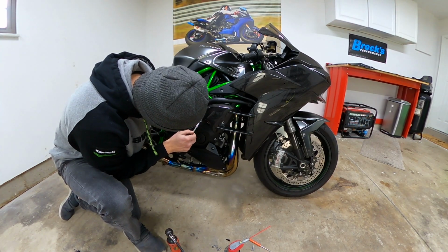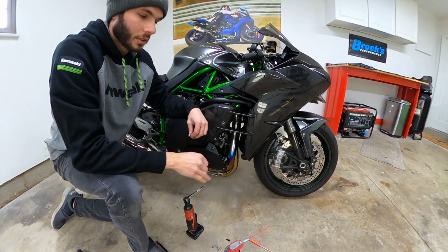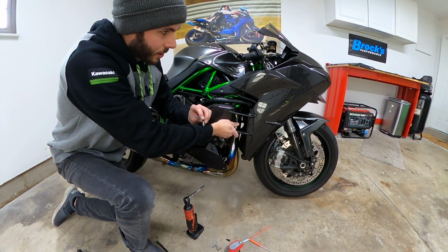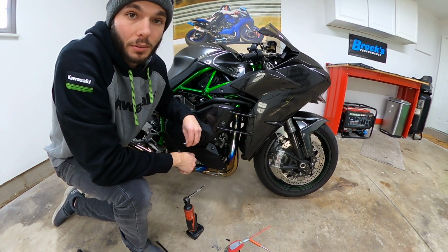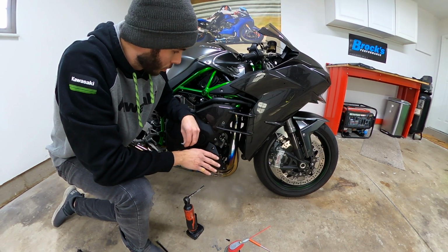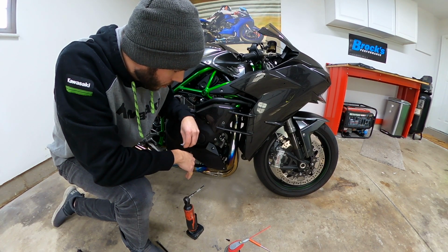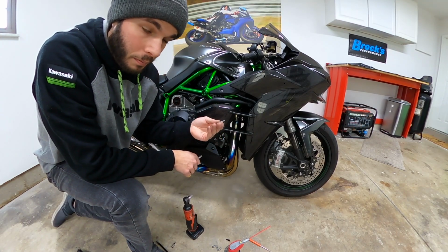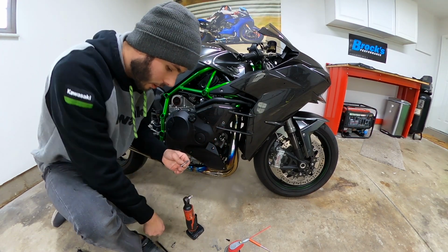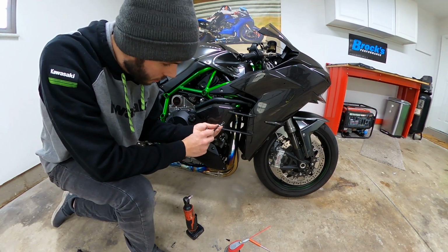Don't attempt this install if you don't have a Dremel. So everything is fitting. I will say that this thing is under some pressure. Definitely not OEM fit. Not horrible, but yeah, you definitely got to Dremel a few things. Another side note on this bolt in particular, put some blue Loctite on it. I have lost a couple of these, and you're also going to want to use your Allen and not your extension to put it in.